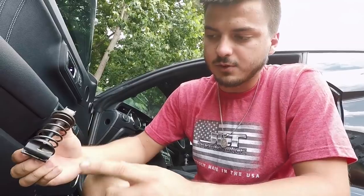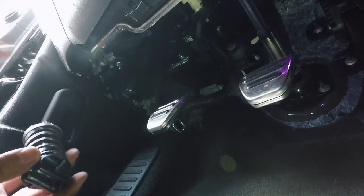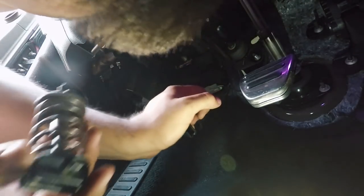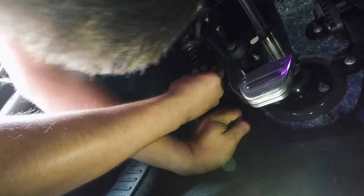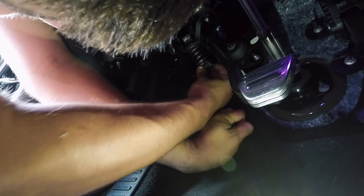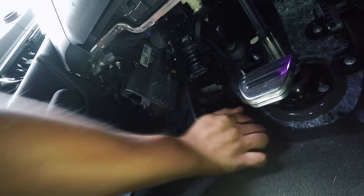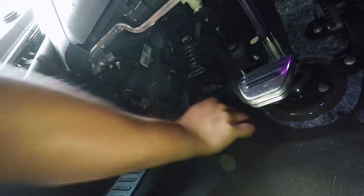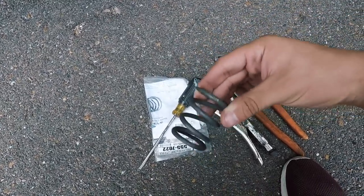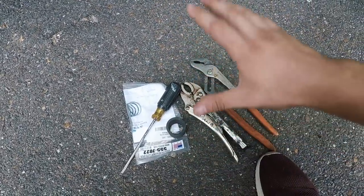Now that we've got the two perches back together with the spring in between, we're going to go ahead and get started on installing this back into the clutch pedal assembly. I'm going to depress the clutch pedal, slide the top into place, work around until I get that bottom perch into place, and let the clutch pedal out. The clutch is back to its original functionality — just a whole lot lighter. We have replaced the factory clutch spring in just under 20 seconds. Very simple, very easy, and super cheap.